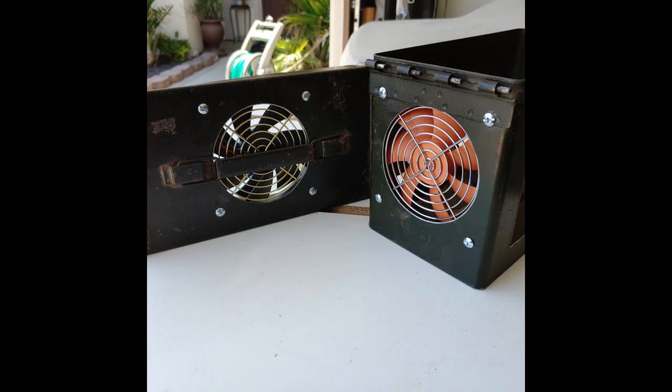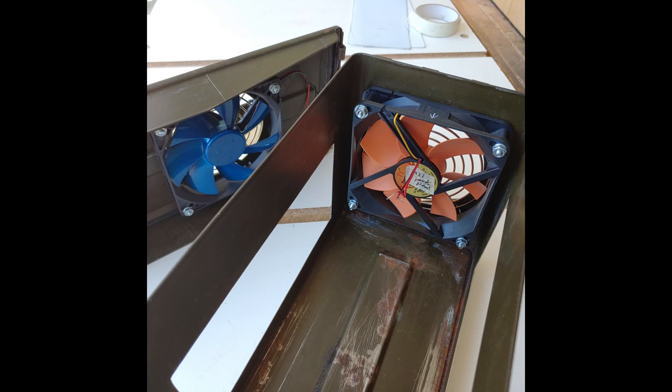Let's talk about the fans for a moment. Putting fans into a small metal box is critical for proper airflow to cool the drives down. I had to put one in the right front of the box, and the only other logical place was to put one in the lid. These particular fans are two full-size PC case fans that run at medium speed. I didn't want high-speed fans unless necessary due to the excess noise factor. The front fan pulls cool air in, and the top fan exhausts hot air out.